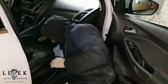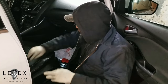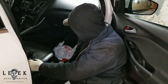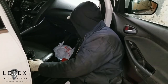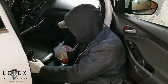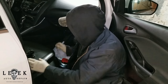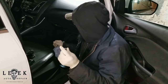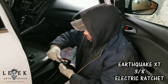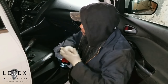I'm going to go ahead and take this off. Let me set this up on a tripod and let you know what tools you need, because this does look like a Torx setup. I think this one is too big — let me come down a size. 45 or 50 — looks like T50 is what it is. We'll use my electric half-inch.